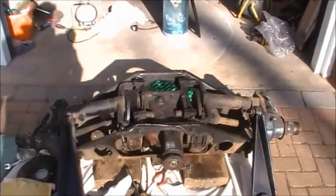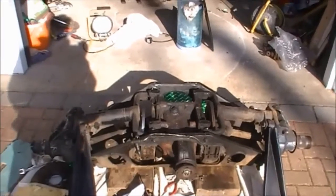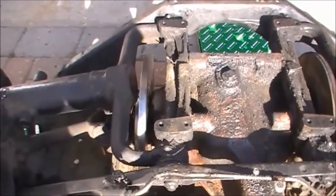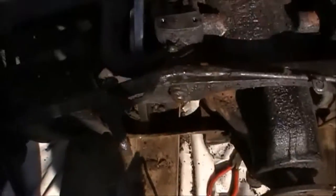It's exactly the same really for a Series 1 or a Series 2. The Series 1 had either Dunlop disc brakes, which were also mounted inboard next to the differential, or the later 4.2 which went to the Girling brakes. My Series 2 has got a Girling caliper on those disc brakes.